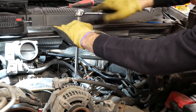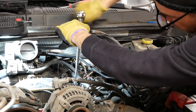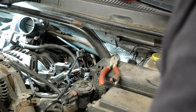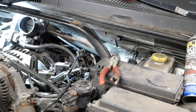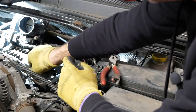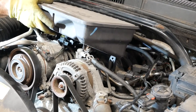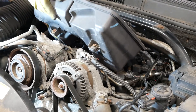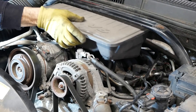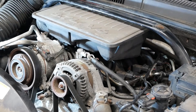Reinstall the two fuel rail bolts, the two ignition coils, and their connectors. Once the fuel rail is tightened down, go over the injectors and confirm they're properly seated, and reinstall the retaining clips. Overall it wasn't too bad — I fixed the problem and have been driving it for a couple days with no issues. I was able to do it without removing the entire fuel rail. At some point I'll probably replace all of them, but for now that's it — if this was helpful please like and subscribe.